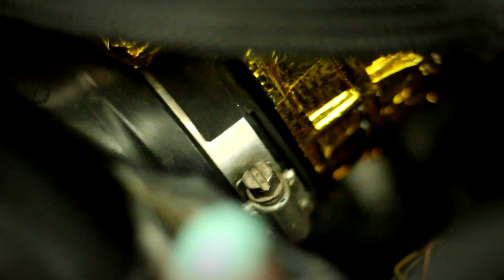As far as the cold side goes, there's this little thin lip on the coupler link — you can see it's like a little dust boot that goes over the hose clamp. That little boot can easily get pinched and get stuck inside the intake manifold or inside the intercooler, and you'll have a leak. So make sure you're really careful putting those back together. Also, if you're wondering — no, these are not the stock Subaru hose clamps. I did upgrade them when I bought the car because the stock ones have a problem with staying tight; they start to loosen and then you end up having all kinds of weird issues. I upgraded all the hose clamps so I wouldn't have issues later.